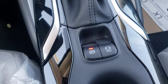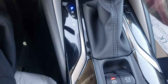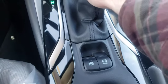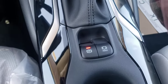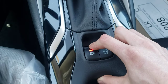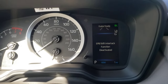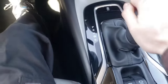Here's something interesting on this 2021 Corolla. You know how when you put the car in gear the emergency brake releases, and when you put it back in park it activates? There's an option where if you don't want it to automatically set the emergency brake, you can push and hold the button — keep holding it — and you'll get a message that the electronic parking brake has been deactivated.